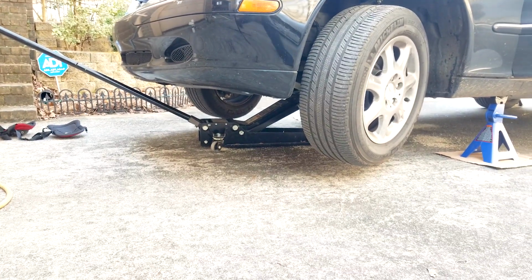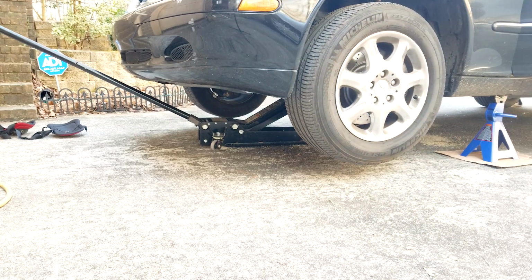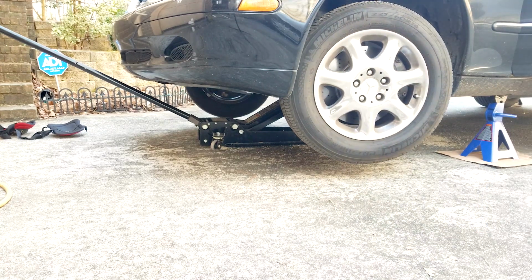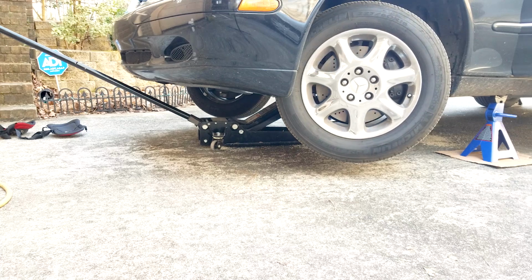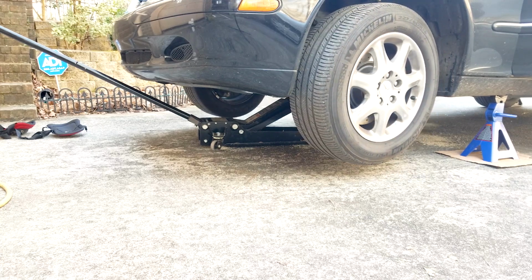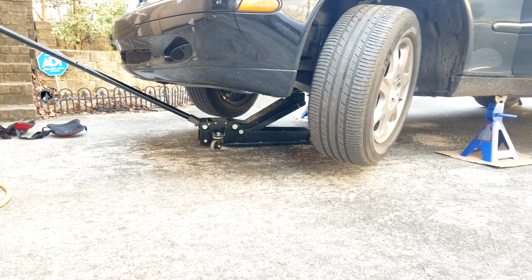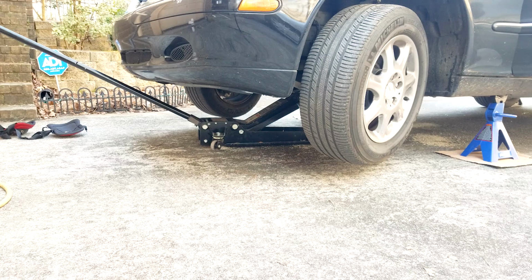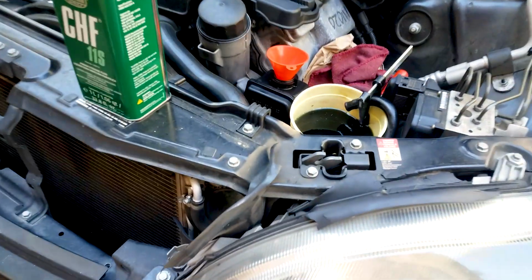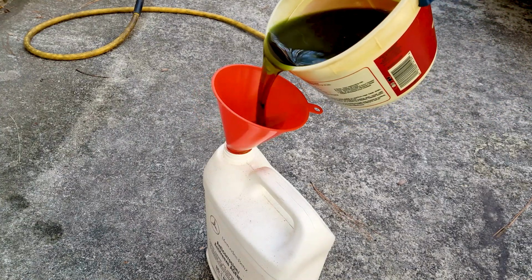And at some point, once you're getting close to 1 liter, if all you bought is 1 liter, you want to do about half a liter, use about half a liter for flushing, a little more than half. I would say 60% of the can, 600 milliliters, used to flush, and then leave some to fill the tank at the end, and then to make the final adjustments.